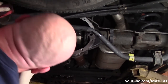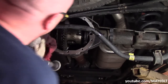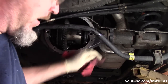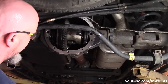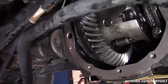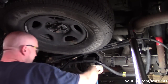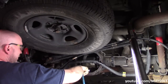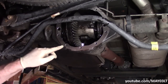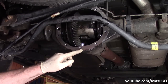You can see if you missed any spots. I'm not going for perfection, but I want to get all the old gasket material off. Since I used my air grinder I've got some debris in there, so I'm going to blow that out. Another thing to mention: you can see on this lip here it's still discolored, but that's not gasket material — that's just crud. The gasket doesn't go all the way down here.